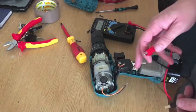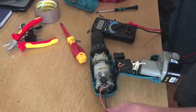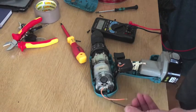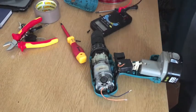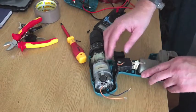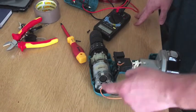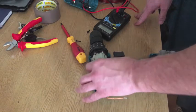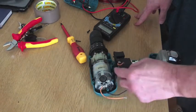Now yesterday when I tested the motor, that had a dead short - so how come it suddenly fixed itself overnight, I don't know. Unusual, but electrics sometimes are. So basically, if you pull that and you get 12 volts up here, you know your switch is alright. If you don't, it could be your motor shorted - so I disconnected these here and tested them here.